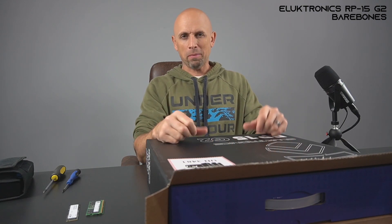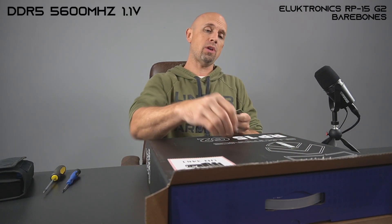You're also going to need the Windows 11 image, the drivers for this system, and you'll also have to purchase your own Windows key to make everything proper. The instructions on the Windows 11 ISO image and the link to the drivers I will provide in the description below. Many of you buying Bare Bones are under the understanding that those are things you're going to have to source. You have to do a little bit of work — after all, it is Bare Bones — meaning you're also going to need your own storage. PCIe Gen 4 compatibility within the RP-15, and memory DDR5 up to 5600 speed and 1.1 volts. You cannot exceed either one of those. Doing so, your laptop's probably not even going to turn on, or if it does, the screen is just going to stay black. We'll talk about a little bit more detail on that as we get inside the RP-15.